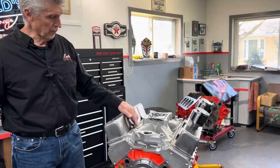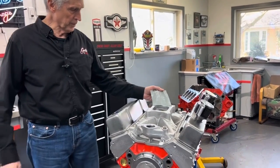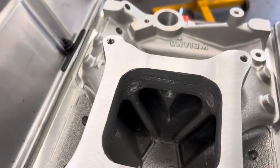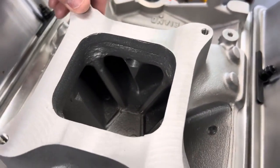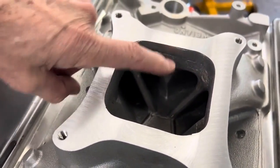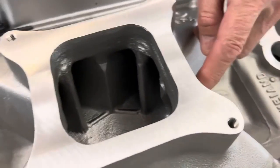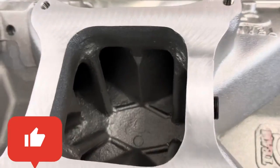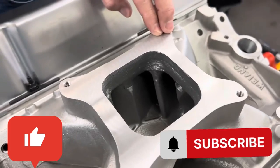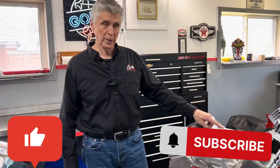For a race application, you use a single plane manifold. As you can see — if I can rip the cover off here, this tape is on so nothing falls in — this is just a mocked up deal right now. There are no pistons or rods or anything in this engine; I just mock it up to make sure parts fit. But as you can see, you basically have a straight shot right at the cylinders on all four corners, with very, very short runners. That is hard on low end torque, and that's exactly what I want, because I think this engine is going to have more low end torque than I want coming off the corner. So that kills off low end torque, but it'll really work well at high RPM.